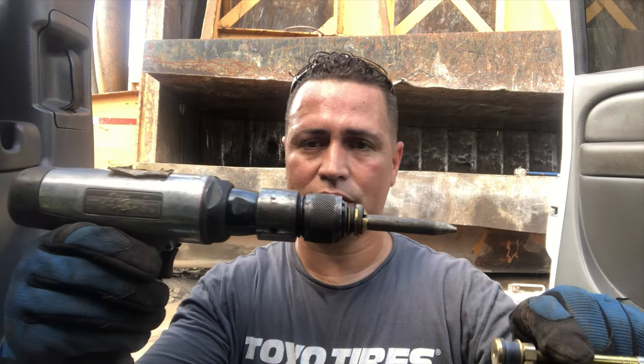Basically, when you got a stubborn valve stem stuck, I use this to go right here in the back of the hole like this and bust it out real quick. A lot of times the wheels are all corroded and everything — you can't get to the nut to take it off, so I'll just use my air hammer and take it off real quick, just like this.